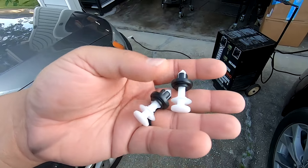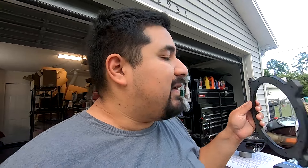To combat that, I'm going to show you some solutions at the end if that happens with your install. You can use longer retaining clips, or you can trim the surround of the rear deck cover, or you could just not use the bracket — drill new holes; it's a weird angle but you can come up from underneath if you measure right. We find the bracket really makes things easier and we're going to do our installation with the bracket.